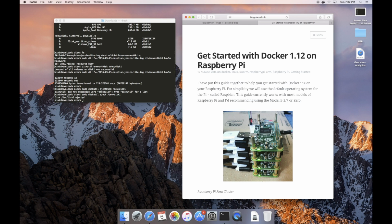At this point you'll also see a white USB connection in my picture. That's actually a USB Ethernet adapter. And what that means is that the Raspberry Pi won't need any configuration for Wi-Fi. You can simply plug this in just like this and apply the power. Now in about 30 seconds I should have the Raspberry Pi on my local network, and it will have the name raspberrypi.local. The username is pi, and we'll be able to use SSH to reach it.